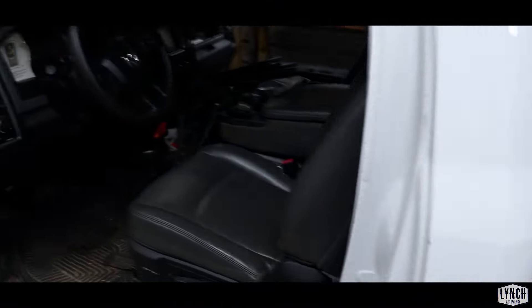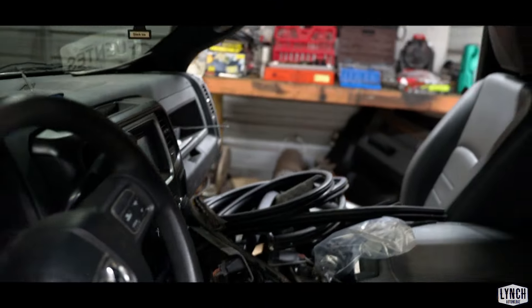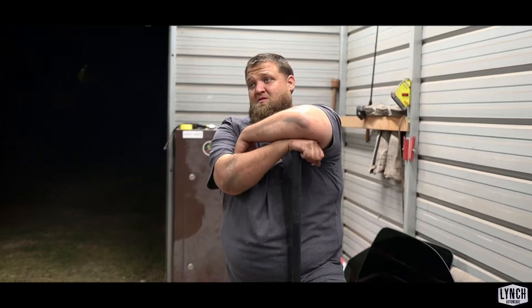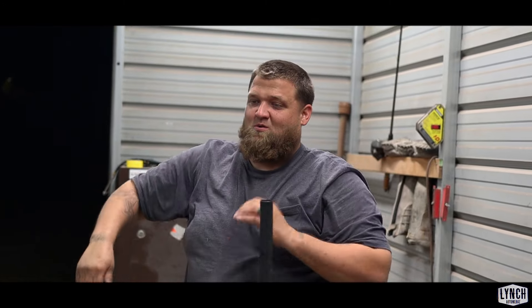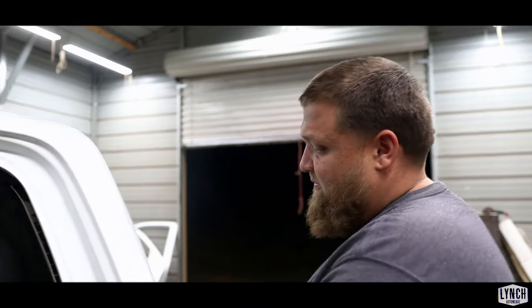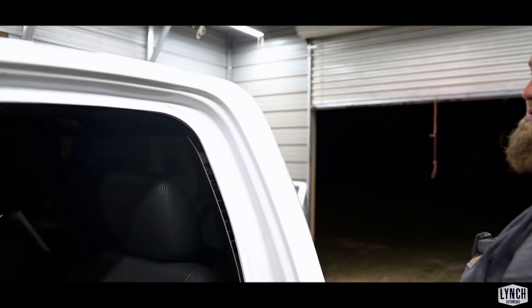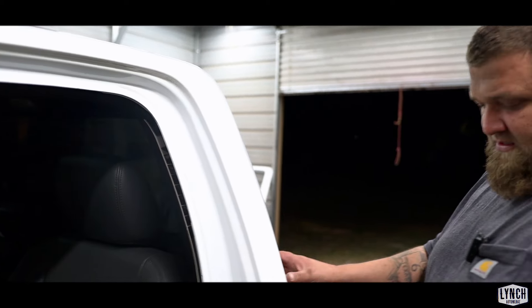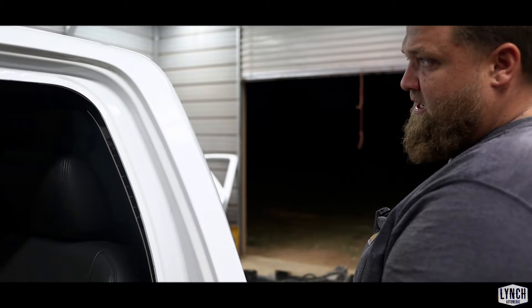We got the bed off, the door is off, all the weather strips and moldings — they got all that off. Front fender's off. Why take the doors off? I'm doing it because the truck is white and it doesn't have any metallic or pearl in it, and I don't want tape lines, so I'm gonna paint the cab all at one time so I don't have to tape off each individual thing. Once the glass gets cut out, I'll start doing the body work and get it primed.